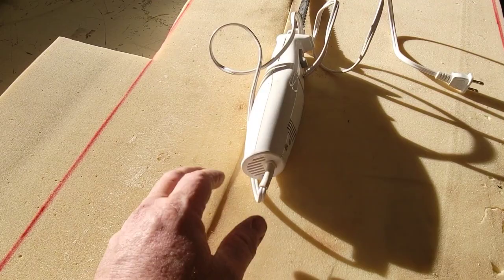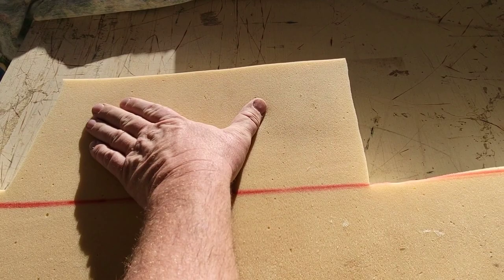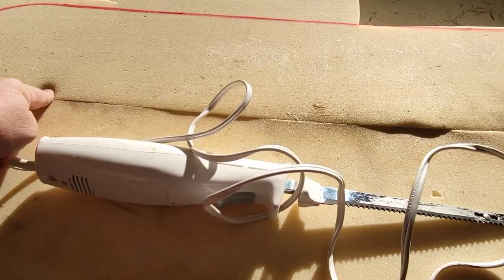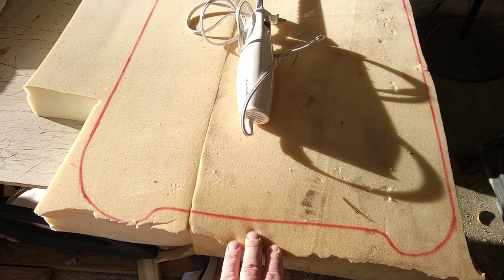I forgot I've got a piece of foam I need to cut out because that's going to go on this new wood. I had two pieces together and when I got over to the corner it wasn't quite big enough, so when I cut this off I'll glue it in over here and trim it out to match. Then I've got some half-inch foam - when I actually make the cover I'll put the half inch on top over everything and you'll never see these seams. The vinyl gets pulled so tight it's not like it'll ever come apart. I'm just using a good old turkey knife - you can get these anywhere at Walmart or order one online. I'm going to get this cut out so we've got something to make a cover pattern from.